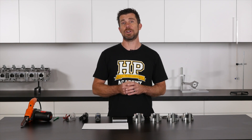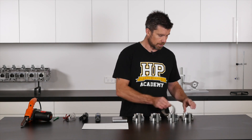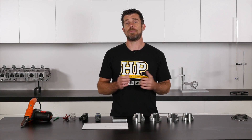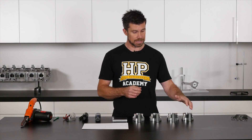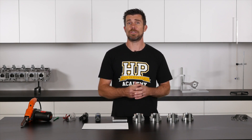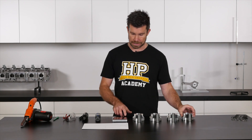In this example we're going to focus solely on our pistons as well as our wrist pins. I've just arbitrarily numbered the pistons as well as the wrist pins using a sharpie marker. This just means that while we're going through the weighing and balancing process, I'm going to know which piston is which and which wrist pin is which. So let's go through now and weigh our components.